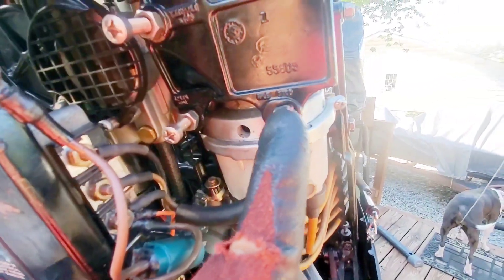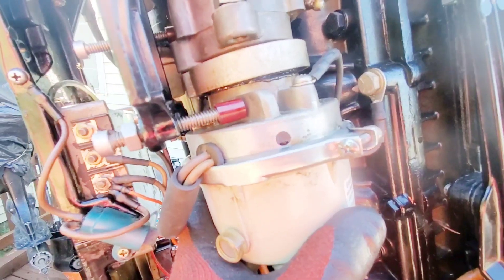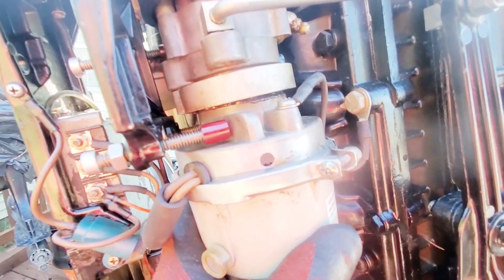After you find top dead center, we're going to be setting the primary, which is right here. I'm going to do this without a timing light. What I did was take the number one spark plug, took it completely off, put a gap tester here, grounded it against here. Set around five degrees — timing calls for four to six. So we're going to gently turn the distributor. Right there, it's already set. So that's going to be the primary, and we're going to lock that screw down.